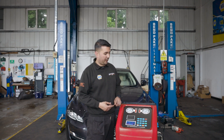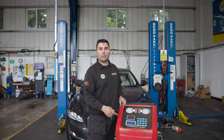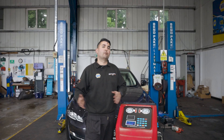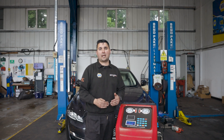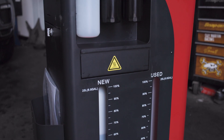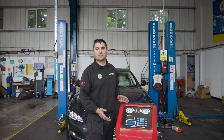With more and more automatic gearboxes coming into the market, I think this is a must-have for any garage, as we're moving away from manual gearboxes. We didn't need the oil heating feature for this car, but for some Land Rovers we know that issue will come up, and now with confidence we can change 100% of the fluid on any car that comes in. It's really good for the forward-thinking garage looking for that next step and additional service offering. Being able to change 100% of the ATF fluid with confidence is a must-have, so I would really recommend this for any garage. Hit the link below for more information on the Sykes Pickavant Fortron ATF exchange machine.